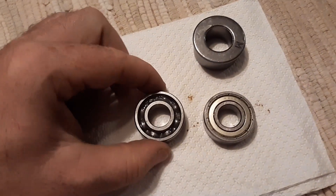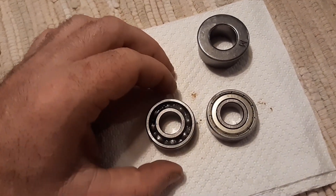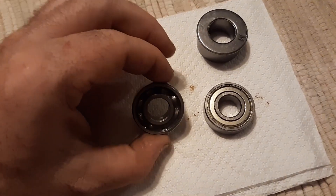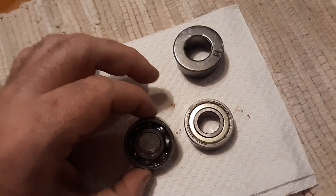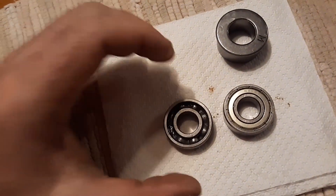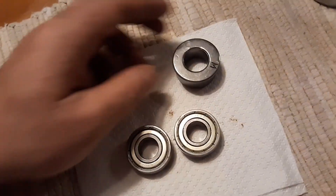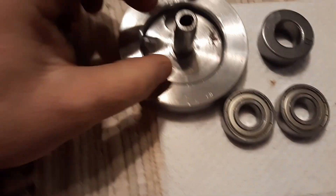When you're doing a crank, make sure you open one side, put some grease in it, and it will definitely help you down the road. A couple seconds of putting grease in bearings isn't going to kill you — you're spending all that time building it, you might as well do one precautionary step that could really save the life of that bearing and make it last longer.